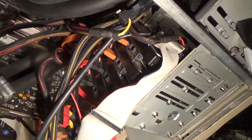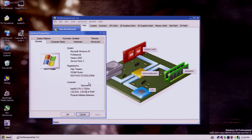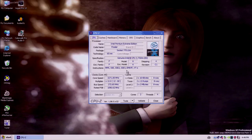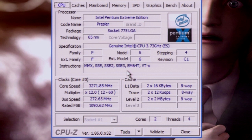As for the northbridge, the A-Bit does have the 955X chipset which is more capable than the 945P the ECS used in some areas — it supports double the RAM and is more likely to cooperate with CPUs it wasn't meant to run. In my case I only have 4GB of RAM installed, but I'm using 32-bit Windows XP so there's no real reason to install more. We can only see about 3GB of that in Windows because this board maps memory weird; we could get about 3.8GB on the ECS board. Meanwhile the CPU under that water block is an Intel QMUJ — an engineering sample of the Extreme Edition 965, which as far as I'm aware is the fastest Netburst desktop chip at 3.73GHz.